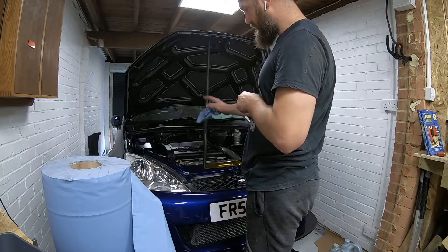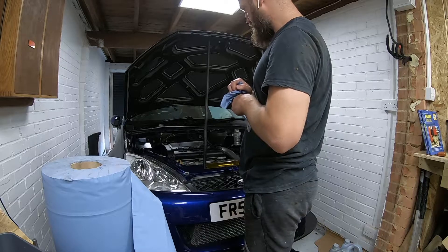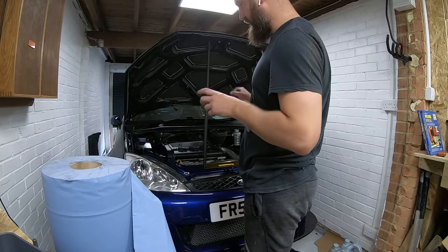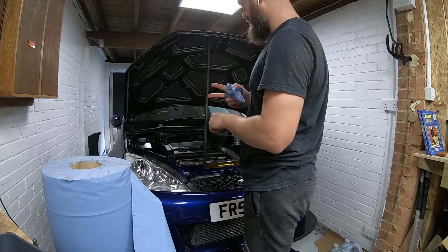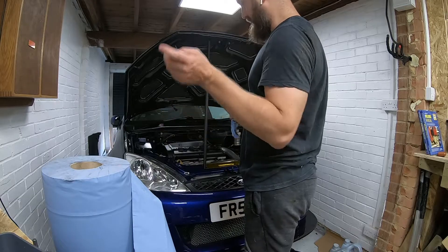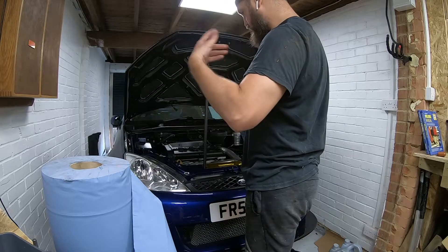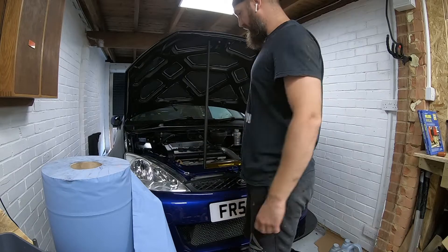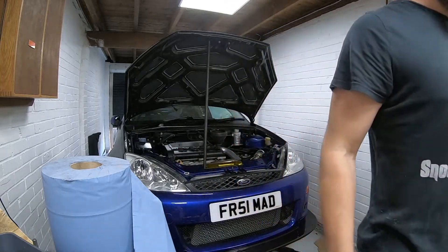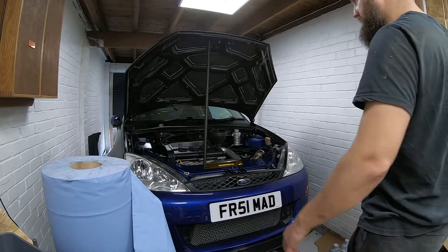I'm going to pull the plugs quickly. Make sure on the ECU all the plugs, coils, and injectors are switched off, and the fuel pump switched off too — I don't want any pressure in the rail just yet. I'll just turn it over to make sure it's all oil-filled, then check for leaks. That's step one — step by step, getting closer.